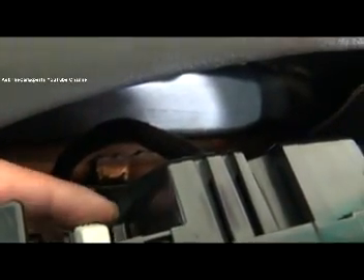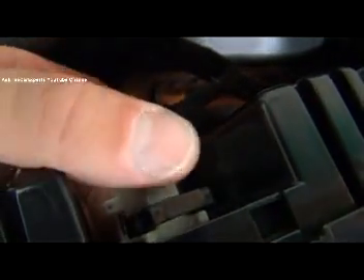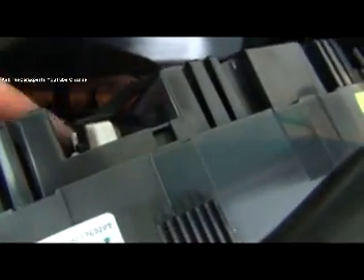I have a white one and a black plug on this one. With it resting like this I can come back here — the way you take these off is there's a little push tab on top and then a tab right here. You push on that tab and this is a slider clip. Once you get that tab pushed down, you slide it back which is going to lift out the connector. They call this the SKE style connector and it's going to slide out. When reinstalling, just push it in and slide it back to lock.